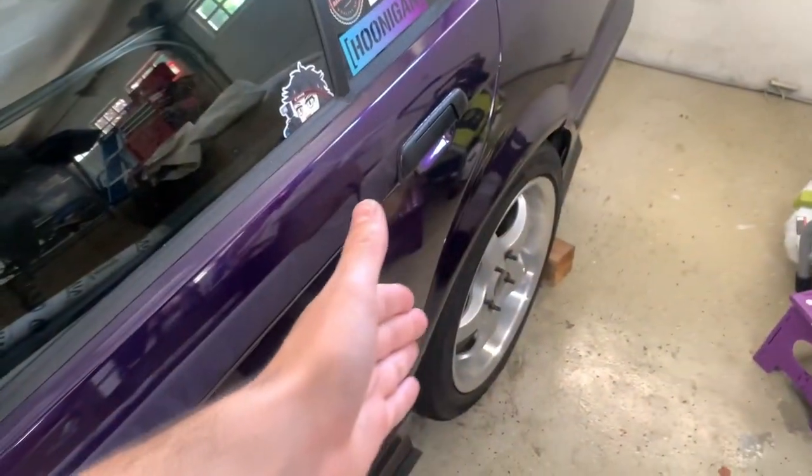After many attempts trying to get this Swaggier handbrake to work, I think I'm going to chalk it up as a fail. I read around a bit — some people have had issues saying it doesn't provide enough force or pressure, and I think that's the issue. It said it was the right size master cylinder, which is a 0.625. I'd put all my weight into it and it'd go all the way up, but it never really locked up the brakes — it would just kind of slow the whole car down, which I already have brakes for. I ordered a new handbrake, so you're going to see that in the next video — hopefully installing it and it works. If it doesn't work, then we know the issue is something else, maybe the line kit. Stay tuned for the next one. See ya.